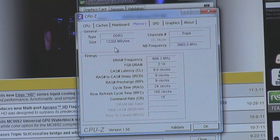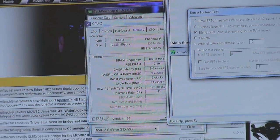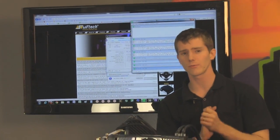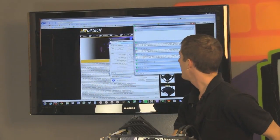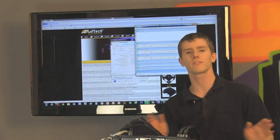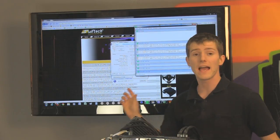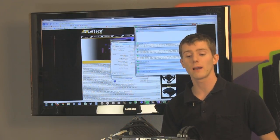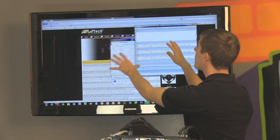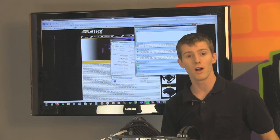Two other things that I would definitely recommend running, because these are the ones that are going to be the most work if you have a problem, are Prime95 Blend for at least 12 hours. I'd really prefer if you ran it for 24. And then also run 3DMark 11 or 3DMark 2006. Honestly, it doesn't matter. Find some kind of a reasonably recent 3DMark. Vantage is also fine. And run that in loop mode for at least a few hours. You have to actively scan it near the end of the run to make sure that there are no artifacts on the screen, that is, any graphical anomalies that don't look like they belong in the image.